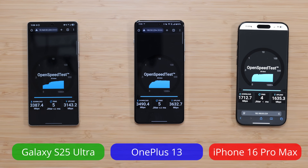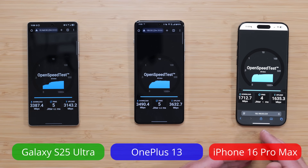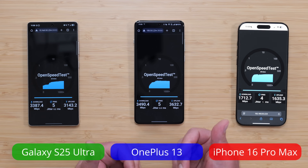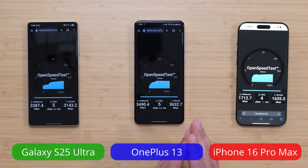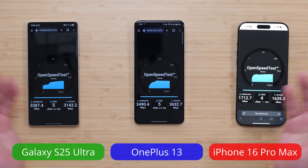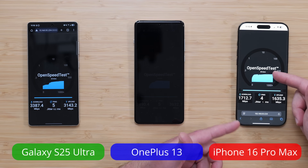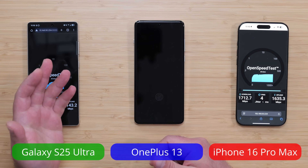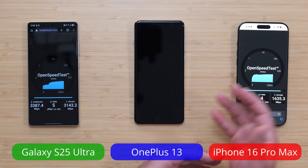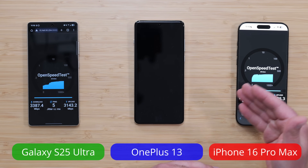The point of the video is that the two Android phones are superior when it comes to Wi-Fi 7 speed tests compared to the iPhone. I've also tested the Pixel 8 and Pixel 9, and those were right around the same speeds as the iPhone, even though they're also Wi-Fi 7 devices. So if you want a true Wi-Fi 7 device from the four phones I've tested, the Samsung and the OnePlus are the way to go. This is why when I do router reviews, if I say I got 3.4 Gbps down, and you have an iPhone with Wi-Fi 7 and aren't getting those speeds — the fastest I've seen the iPhone go is about 1.7 — it's not necessarily the router.